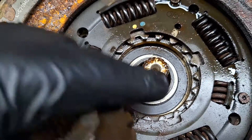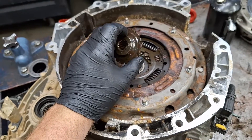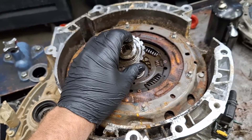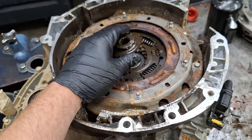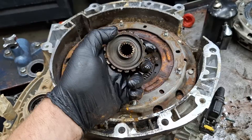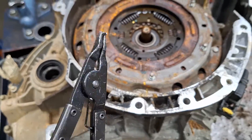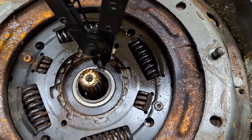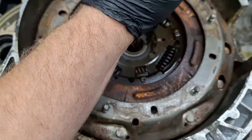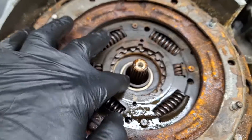There is water on top of this inner seal here. So I whacked it with a hammer and a 36mm socket and eventually it bounced up a little bit after I sprayed penetrating oil on it, and then I was able to work a screwdriver under it and pop it out. Snap ring pliers — snap ring. Remove that and throw it away; it's one-time use. Squeeze it out and flick it like that. It is out.